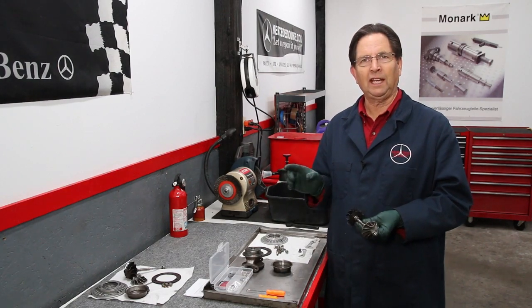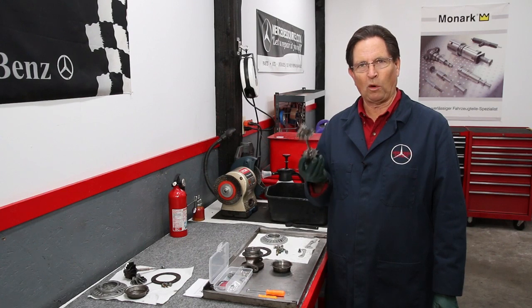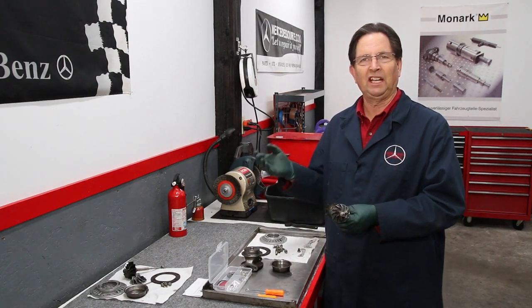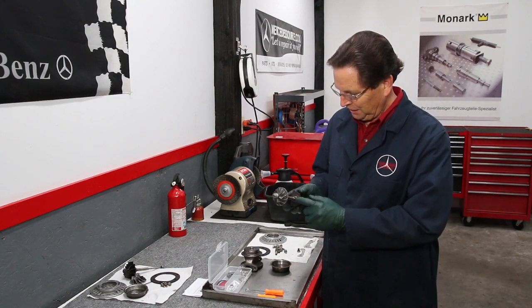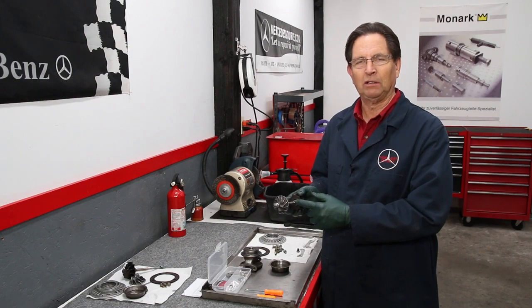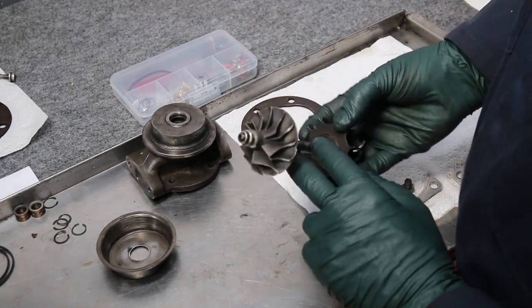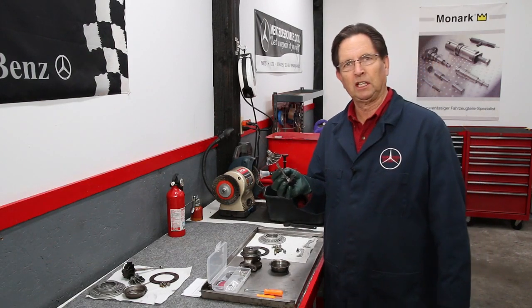When you get this apart, one of the biggest mistakes people make when they overhaul these is they try to reuse a worn-out turbine shaft and compressor wheel. Sure, that costs money, and you think it's good enough — as long as you have new seals and new bushings, you'll just reuse the turbine wheel and shaft and compressor wheel. But the biggest problem is this groove in the sealing ring. It wears with age, and if the gap is too big, you're going to be pumping oil into your exhaust. Don't be skimpy. If you see scoring on the shaft, excessive wear in that rear sealing ring groove, or any damage to the vanes — particularly on the compressor wheel because it's aluminum — wear marks, chips, or nicks — these parts should be replaced for top performance.